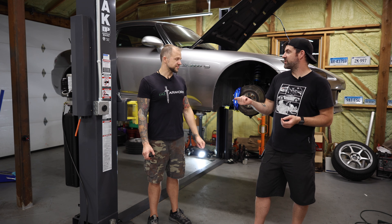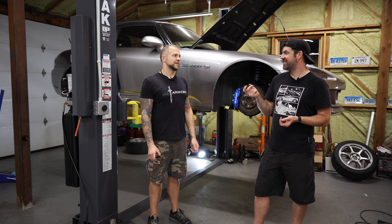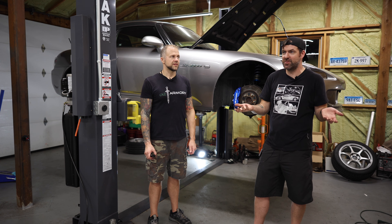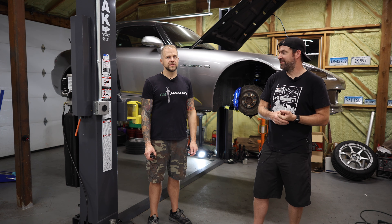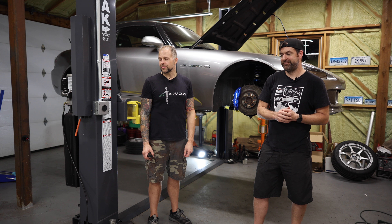There was also another thing with the ball joints — the nuts that came with some of the ball joints. When you tighten them all the way, they go past the hole for the cotter pin. And they're castle nuts too, so essentially they can loosen up and then you're going to have slop in there. We ended up reusing the OEM ones — they're okay — and then we put cotter pins on them in the proper location.